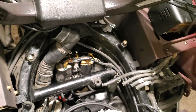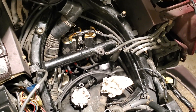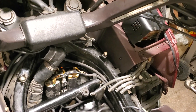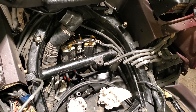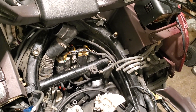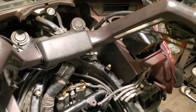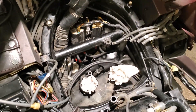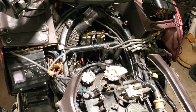The way they designed the bike, you must take that carburetor off. So while the carburetor is off, I'm saying to everyone out there — why not change the thermostat? Because if your bike is like mine, it's 31 years old now. Time to change that thermostat; it's the original. While you have the bike apart and you're already into this part, do it. Save yourself a lot of headache of trying to replace that thermostat later — otherwise you'll have to tear the bike apart all over again. Alright, next video.